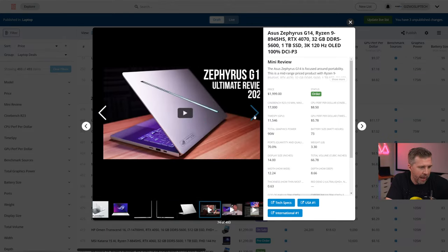I'm thinking that some setting on this display is incorrect right now, and it's reducing our color gamut on the display. And that's why I was trying to look in here as to where the display control settings for the color gamut are. And maybe HDR support needs to be turned off or on. So HDR is currently enabled. We can try disabling that. There's also a color profile right here.